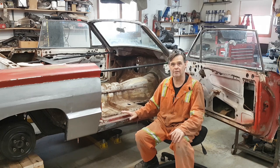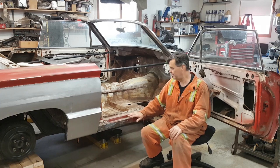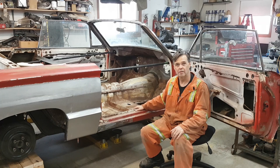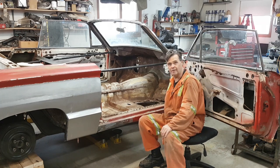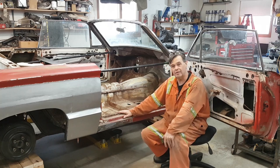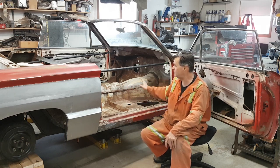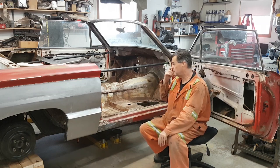So there's more than I'm going to be doing here than taking off just a quarter panel. I'm going to be taking off the rocker and I'm going to be inspecting the inner structure behind the rocker. I already know up here with this floor piece that the inner part of the structure has a hole in it, so it needs to be fixed. So that brings me to another task that I had to do - supporting this area, making sure it doesn't fold.